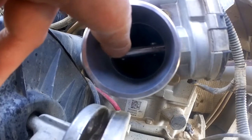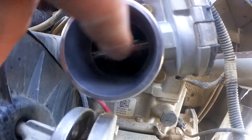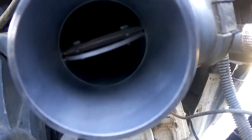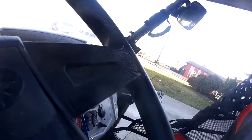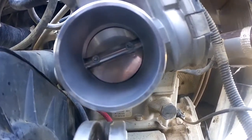After that, get in there with the towel, gently wipe it out. The edge of the butterfly here, you want to clean that. Generally, if you do regular maintenance on it, it won't get so bad — it's usually dirt right on that line area that will clog you up. Then come back, turn off your ignition, remove the throttle stick, and it pops back. Looks like my throttle body is nice and clean — easy maintenance.